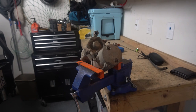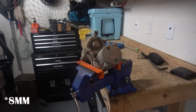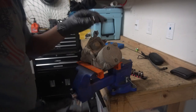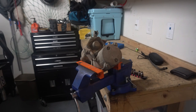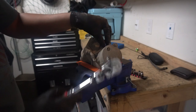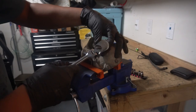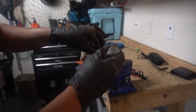I'm going to take apart these three bolts here — I thought they were 7 millimeter but they're actually 8 millimeters. Just take them all off and see what we've got inside. As far as I know this is the original starter — you can tell by looking at it, it's super old and it's never been replaced.